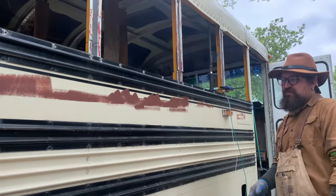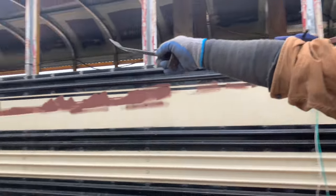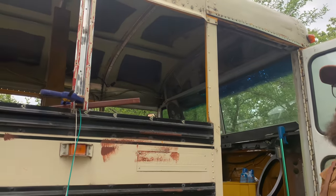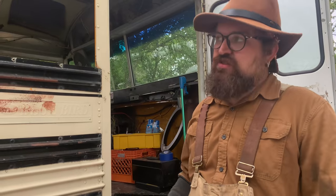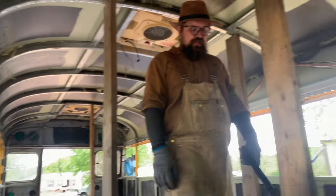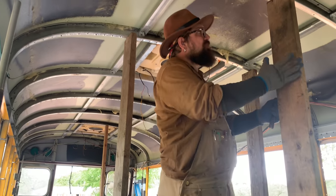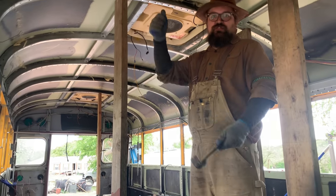It's like art — you just have to go with the mistakes. It could be patched and repaired, but okay. Right now what we're doing is going into the corners and removing the things that are binding the last bit of hat channel — the edges holding the roof in place. Once those are loose, everything is free and can just be lifted. We've got a couple of bottle jacks on the floor to help push the roof up — the jacks just push, then we settle the bolts, tighten a little more, add new wood, then jack some more, using them in conjunction with each other. You have to go back and measure to make sure it's level.